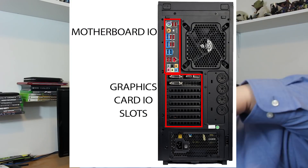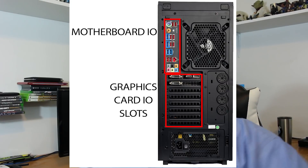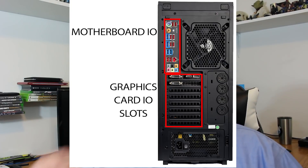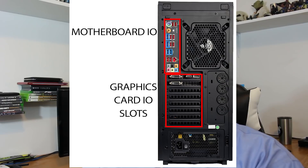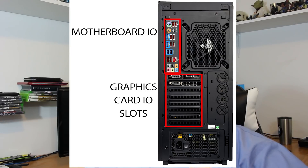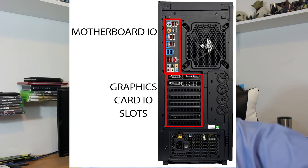However, if you've got a desktop PC — and I'm guessing most of you do — if you look at the back of your computer, you're going to see a big long strip of ports. There's going to be USB, probably Ethernet, display ports, HDMI, things like that. But you're also going to have vertical ports going down like this. Now you might only have one, and if you have a dedicated graphics card on your PC — either NVIDIA or AMD — you're going to want to look at that. Those vertical ports going down, not the big long I/O strip on the back of your motherboard — that's the graphics card.